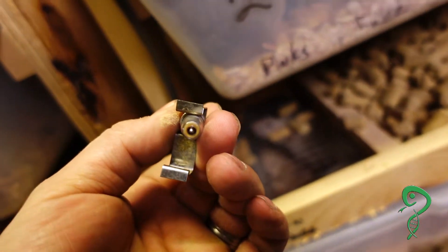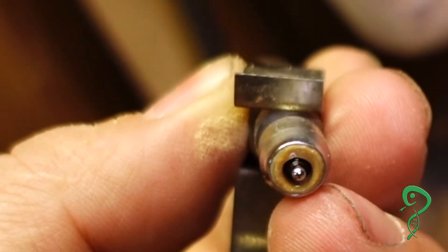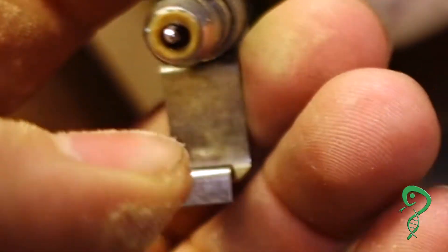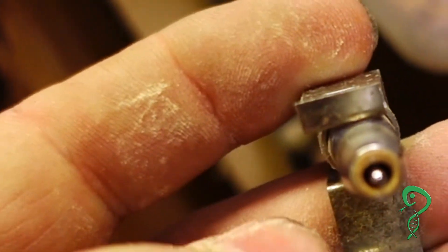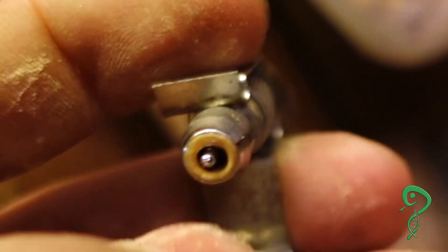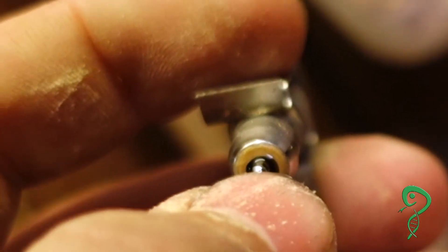I have a little bit harder water. If you look inside, you'll see a little ring of hard water crust. Usually what I do is stick a small drill bit along the side and run it, moving it around to help break up that crustiness. Because if that builds up all the way to the plunger, they're not going to get any water out of it.